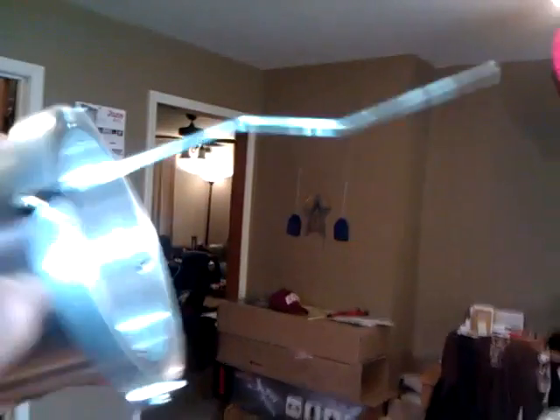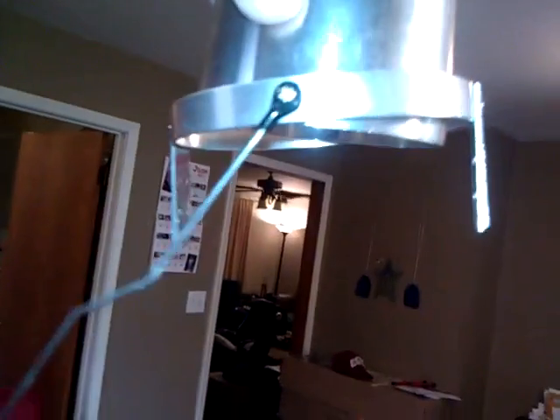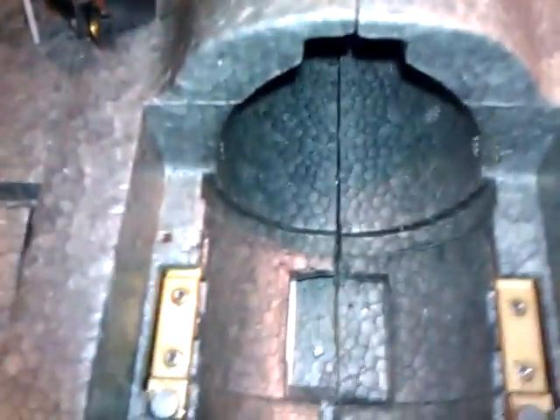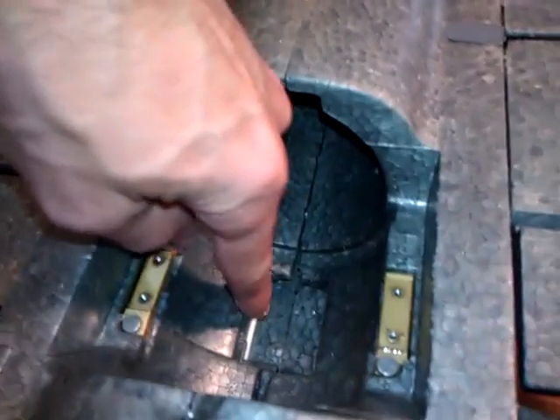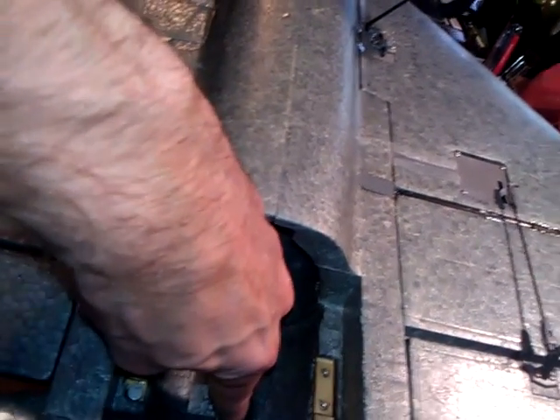That control there is what will give me my up-down, and that's the left-right. That'll give me my left-right swivel once my little brackets are mounted in. The one push rod I'll have coming through the top - I went ahead and took the fan out because it's going to be so much easier. Normally this is where my wires come in for my ducted fan from the speed control, and that push rod right there is the rudder push rod. So I went ahead and ran in the push rod on this side, which will act as the rudder push rod for the thrust vector. I've already fit that in there, got that all cleared - it fits perfect.